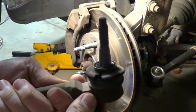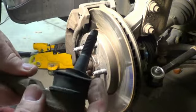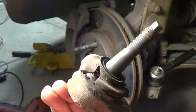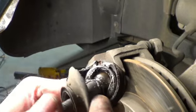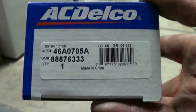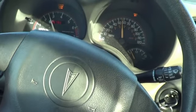This is probably the factory one — this one had no grease zerk, permanently lifetime greased. It actually still moves around pretty well. But as you can see, the boot is just completely disintegrated on this one, so it wouldn't have been long until moisture got in there and that joint went bad. I went ahead and grabbed that boot and just kind of ripped it off — you can see what's up inside there: there's just a ball in there.